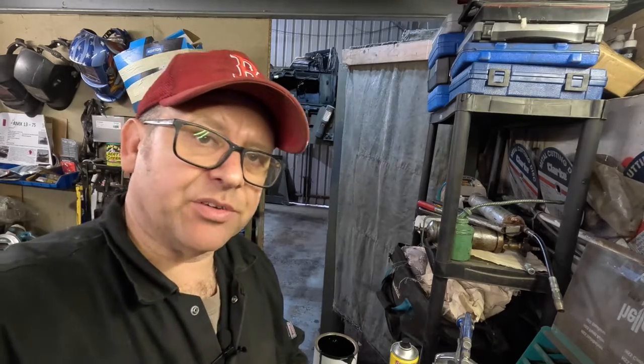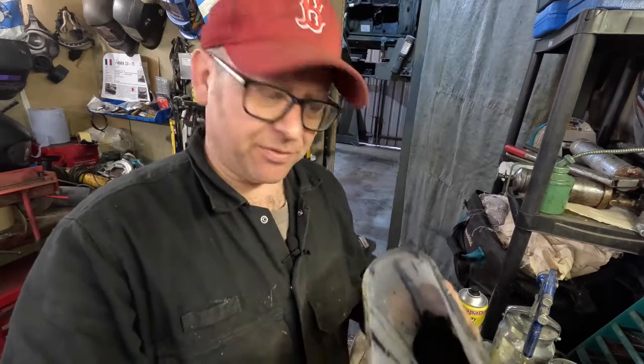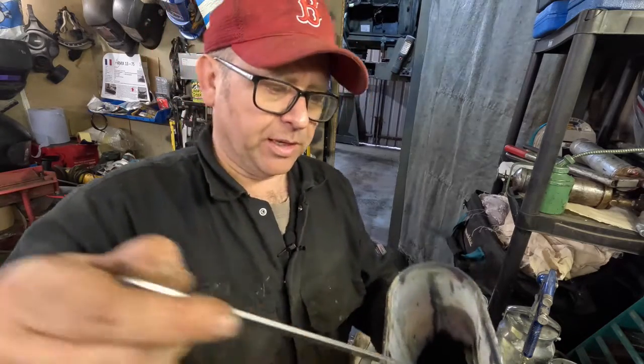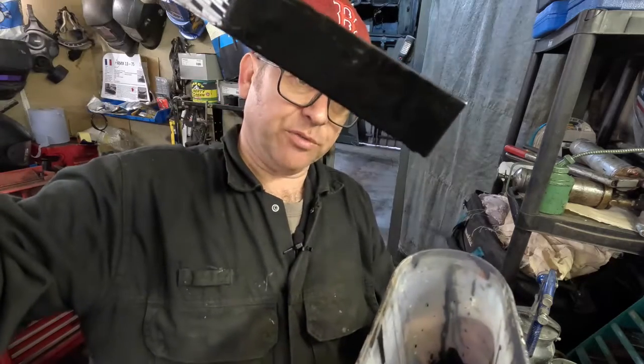One might say, how do you know if the paint's ready? The way of thinking about it is, it has to be quite thin. I would describe it as one step up from tea. You really don't want it thick, maybe like Coca-Cola even. So what you're really looking for is when you're dripping it off the end of your stirrer, you can really see how that's running away. You want it to be just a little bit thicker than water in a sense. And that's what we're going to be putting into the gun.